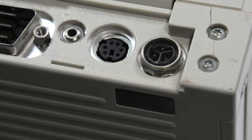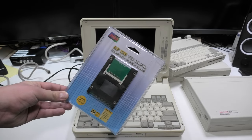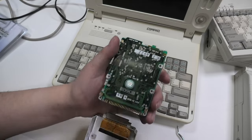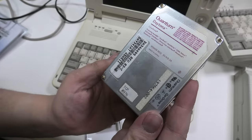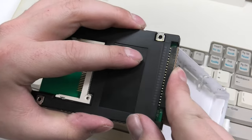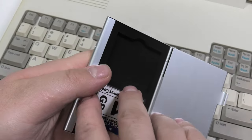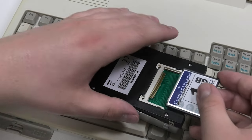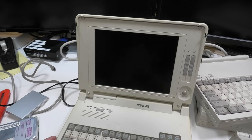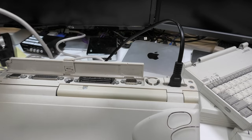Additionally, this one suffers from a damaged power port. So I think the best first step is to see if we can install a 2.5-inch IDE to dual compact flash drive adapter. I removed the hard drive from the laptop — which is very easy — and took it out of its caddy. Then I took the compact flash adapter; you can put two compact flash cards in it and it's quite a sturdy piece of hardware. It fitted very well in the caddy. I then got out a 1GB compact flash card to try. Testing it in the laptop, this time it doesn't give an image at all — I even tried the VGA output but no image showed.